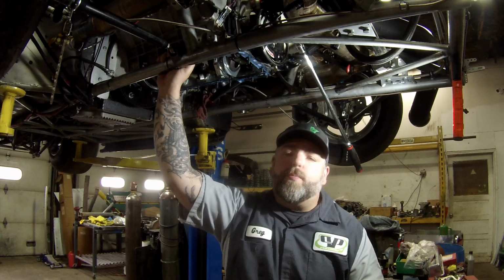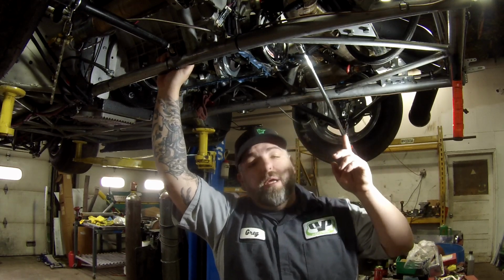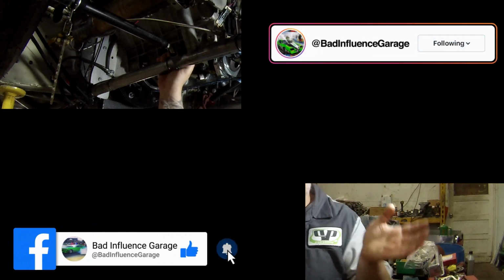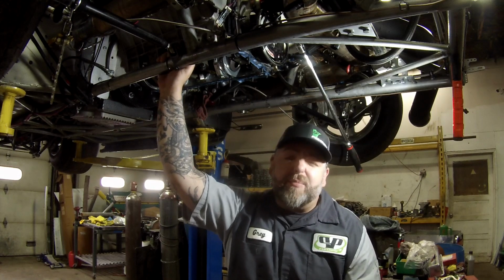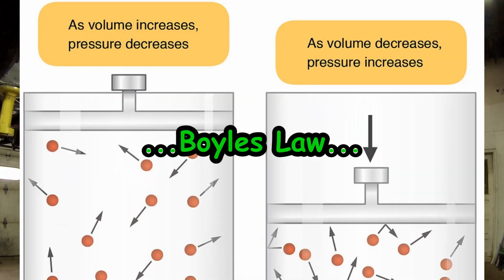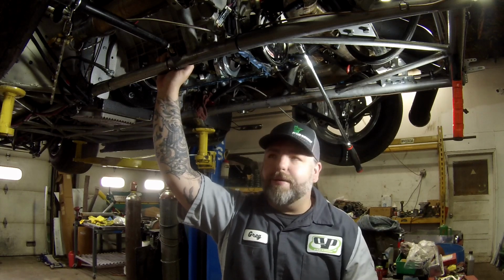We believe the oil pressure drop that we had came from the turbo, actually. We had a restrictor in for the turbo feed, and then we took it out, and that was the same time when the oil pressure on our data came down. It may not seem like a lot, but we opened it up from like a 40 thou orifice to like a 200 thou orifice, and that's going to be enough to make everything kind of drop out. So we just put a restrictor back in. We opened it up a little bit and went to like a 62 or 64 thousandths orifice, so we should get that pressure back at the top end.